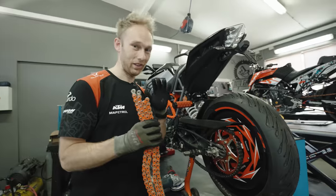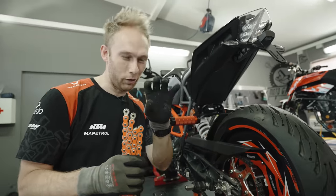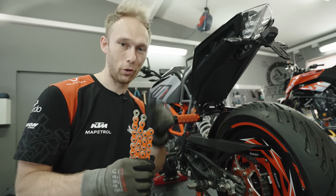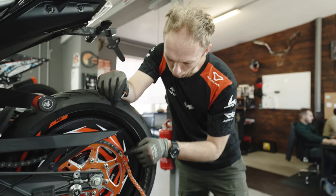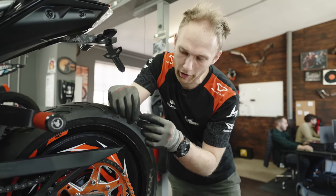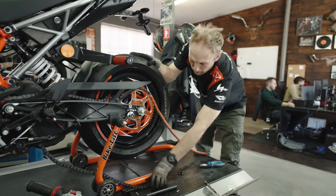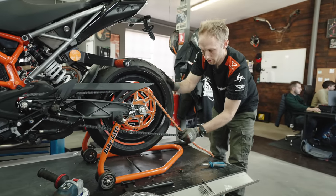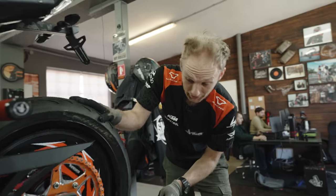I have a quick tip for replacing the new chain to avoid fiddling around the tight spots of the front sprocket. Here's a quick Rock On tech tip: connect the new chain with the old one — I did it with a zip tie or the pin that comes with the chain — and then just super easily pull the old chain through. Voilà, that's it.